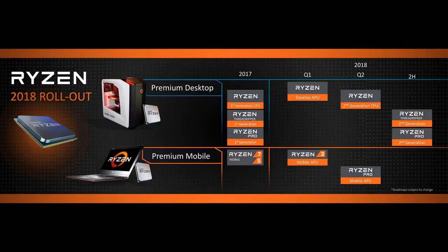The best bit about this for me though is that it's a really future-proof system. The AM4 platform that the motherboard supports will be supported officially by AMD until 2020, so a new Ryzen processor, whatever they may call it, that comes out this year or 2019 or 2020 will still work on that old B350 ASRock motherboard from 2017.